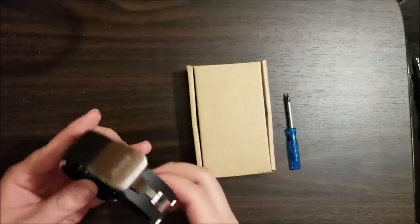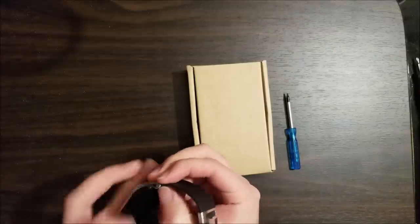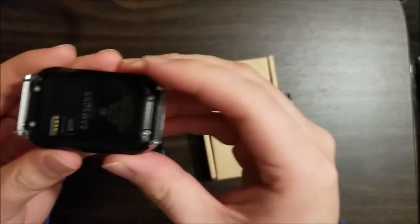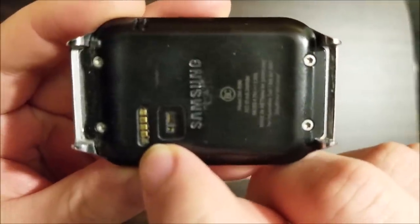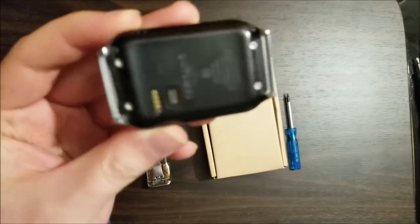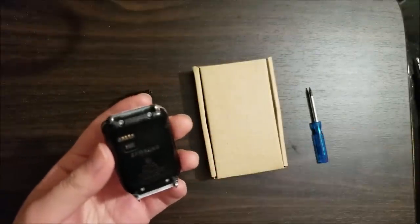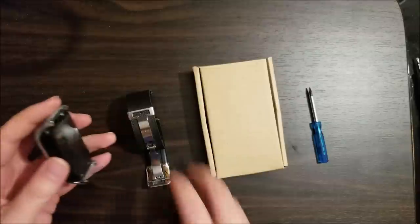The point is, if I remove the band, you can actually see that there's some corrosion and it's making it pretty difficult to charge the watch — it'll just disconnect. You can hopefully see right on the end there, that's actually the 5 volt pin, which is like the worst pin for that to happen. So if you don't press the snapping USB charger adapter thingy to the end, sometimes it'll just sit there and not charge the whole time, which is really annoying.